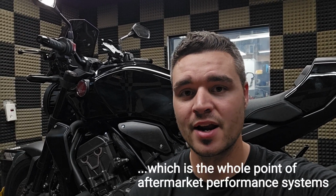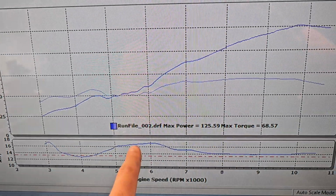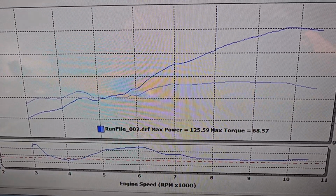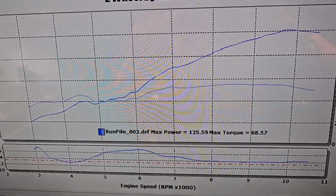Now, any bike with an exhaust flapper in the stock exhaust system is going to be really lean once you remove that. It creates a ton of pressure in the exhaust system, so all of a sudden you dramatically change airflow by removing the stock exhaust and putting on an aftermarket system. But this one's exceptionally bad. Normally when I see something like this, you're talking about maybe 30 or 40% more fuel to get the bike back to where it's actually properly running with a correct target AFR.